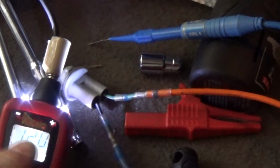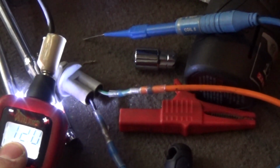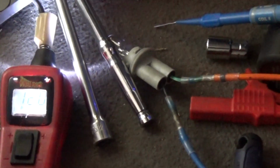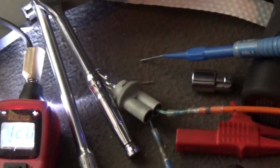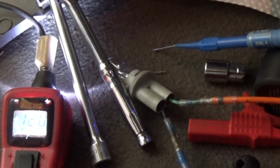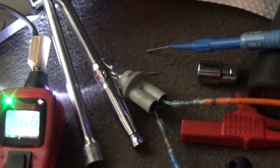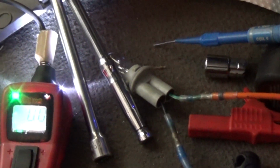That's basically that the body control module is sending 12 volts, and the switch pulls that down. It's a pull down design. It's going to pull those 12 volts down, and that's basically on and off. The 12 is off, 0 volts is on. All that is working. The body control module is not responding to it.